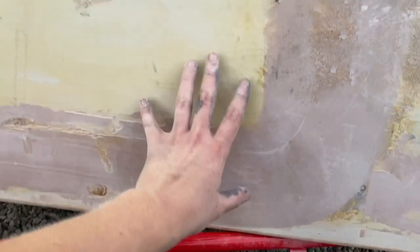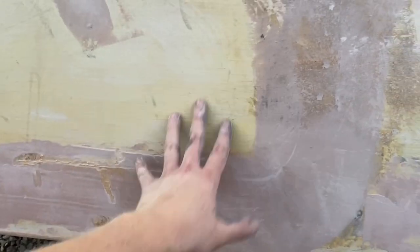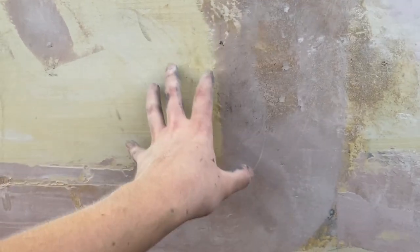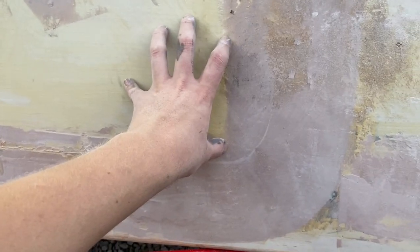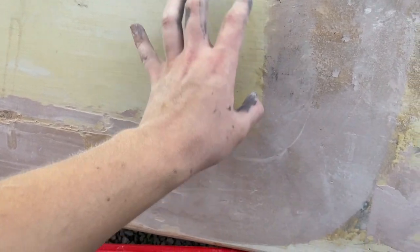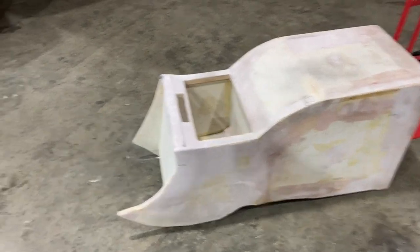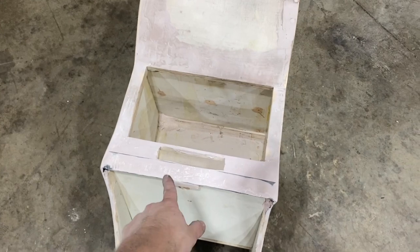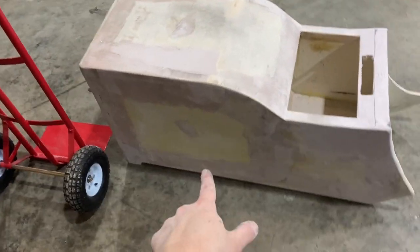Before I bed-line it, I want to go ahead and put the aero port in. We're actually going to be adding a four-inch aero port — based on the box calculators, I think we'll do it eight inches deep or maybe ten inches deep. I'll have to cut out a circle in the box and put the aero port in. Hopefully it doesn't get completely covered by the seat and lets it breathe. In the next video everything will be sanded, spot putty done, and we'll be ready to figure out exactly where the aero port is going to go. I did get the sub box back in the truck, so let me show you inside real quick.